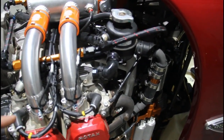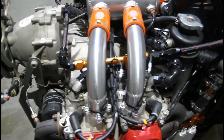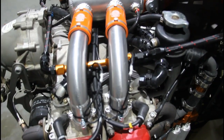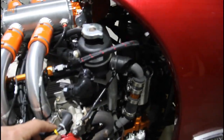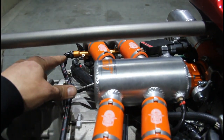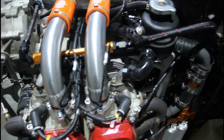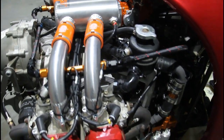A little trick on relocating: these little elbows — you can unscrew the two bolts and they just have an o-ring under them. You can relocate them without having to re-index or turn those elbows. If I'm remembering correctly, the number two cylinder elbow moves over to the number four cylinder position and the number four moves to the number two, and in that location everything lines up and works pretty well.